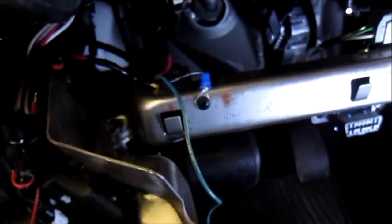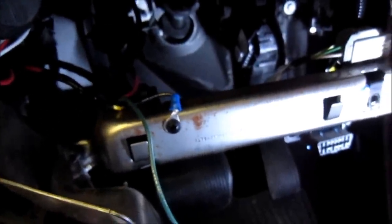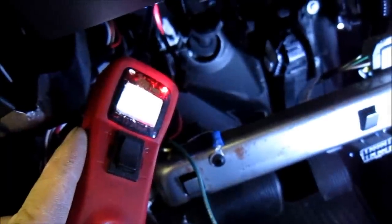Alright, so I'm just in the middle of wiring up this sucker. We need constant, accessory, and ground. Ground's pretty straightforward — you go straight to metal. We're using our trusty power probe to test everything. For constant, we're hitting the ignition wiring and adding our own fuses. That's constant. And now we have accessory hooked up. First you're going to see ground, and then when we turn the ignition on it's going to go to 12 volts power, and then during the crank cycle it's going to go back to ground, and then back to power again once the vehicle is running. The reason accessory does that is because during the crank sequence we don't need those devices to be powered up — that's why your radio shuts off when you turn the ignition. All the power goes to the starter and ignition components.